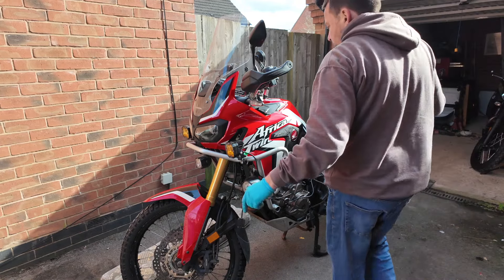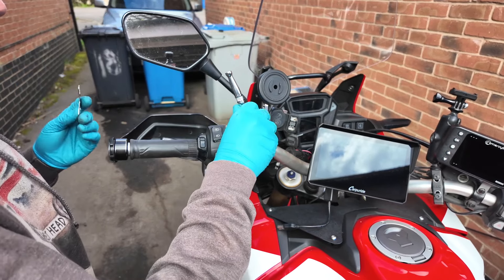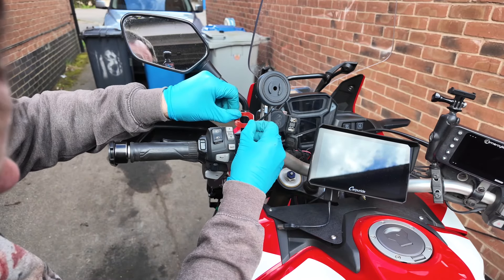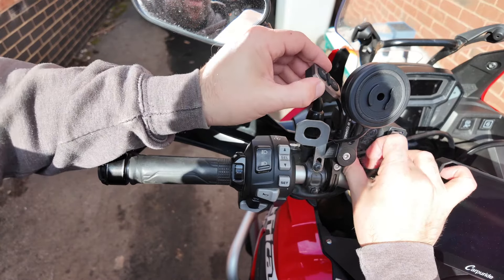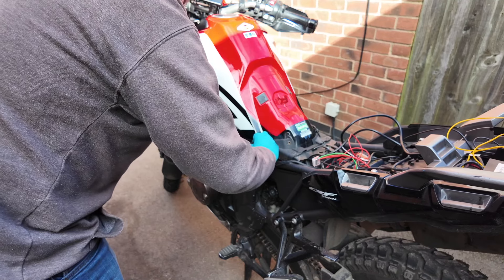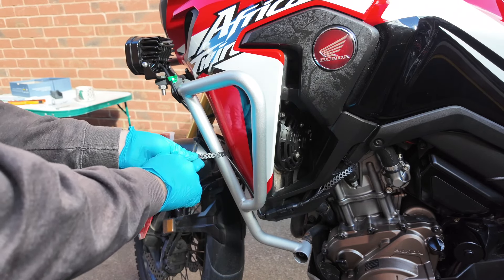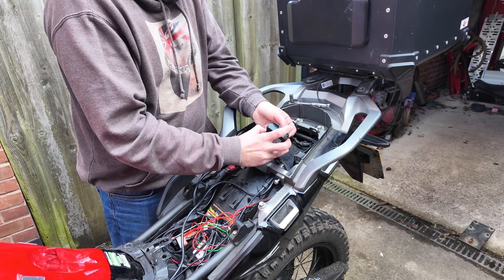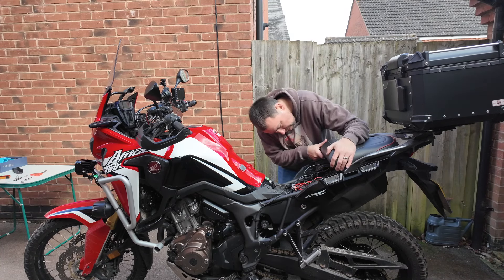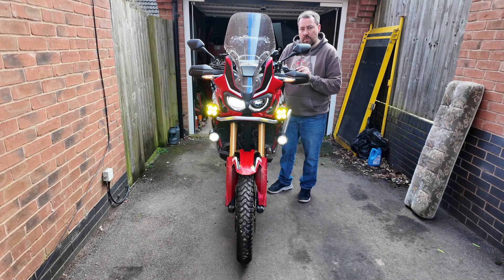Next, take your controller, run the wiring down the length of your bike, and then decide how you'd like to install it to your handlebars — there are different options available. I've decided to attach it to the mirror mount, which was really simple: do one bolt, pop your mount into place, and tighten the bolt. Take your 3M sticky pad, put that onto your mount, then attach your remote with a little pressure and after a few seconds it'll be nice and secure. With all wiring in place, put back on all your plastics and tidy up the wires using plastic ties or rubber ties to make sure everything is secure and nothing's touching your engine bay or hanging down. The wiring box I secured underneath the seat using another 3M sticky pad. Simply put your seat back, start up your engine, and check that your lights are powering on and going through all the different strobe modes — installation complete.